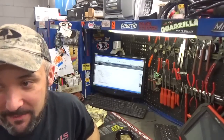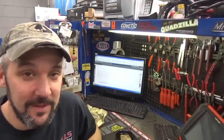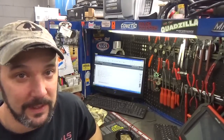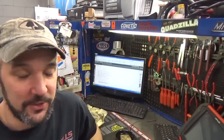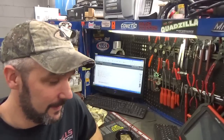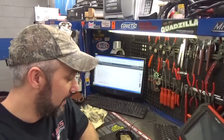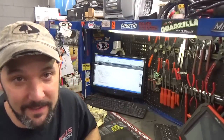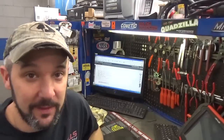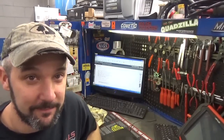And besides, that's what made this whole job a pain, because I couldn't see the initial leak with that big sponge in there because it was just absorbing all the coolant. And you couldn't see, so we had to pull the intake to take the diaper out to see where this leak was generating. I'm going to leave it out, right or wrong. Please don't judge me on that. I do read a lot of guys online that are leaving them out, because they think it's the root cause of the problem. So I'm going with that theory.